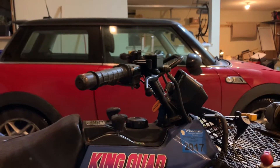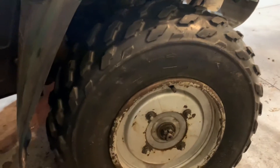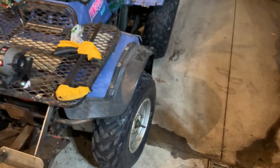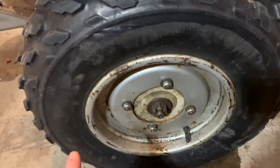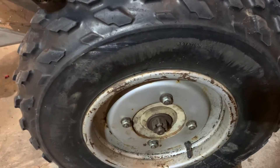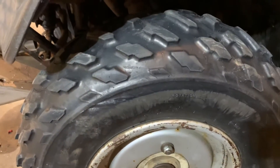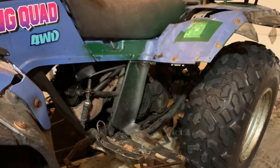Another problem is the front brakes. I've replaced the lever and the cylinder up top, put new-to-me brake hubs on both front wheels, and new pads, but they're still not grabbing. I think there's a ratchet adjustment in there that I may have set incorrectly. In fact, the drum got stuck on, the wheel seized up, and I had to drill out the back and pound it off — it was a real pain.